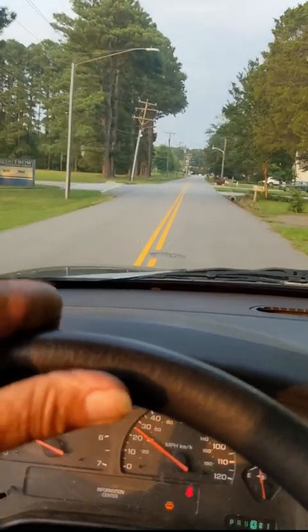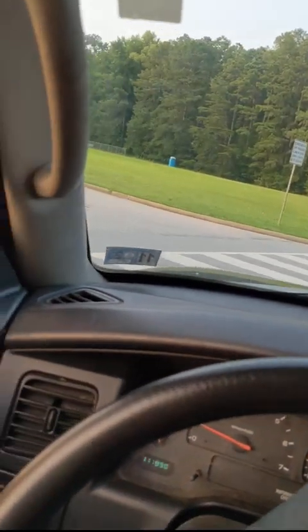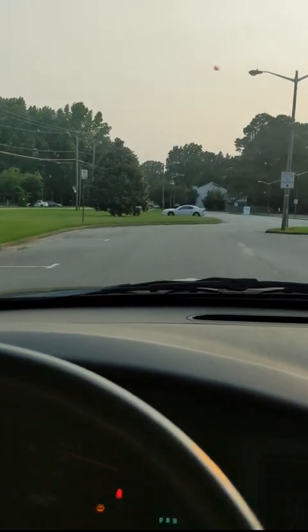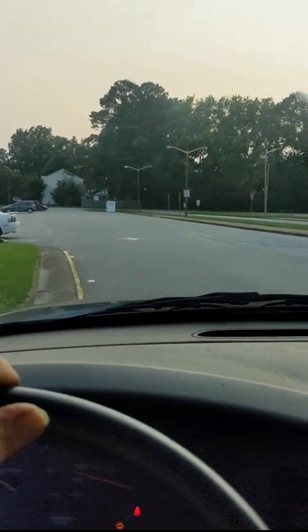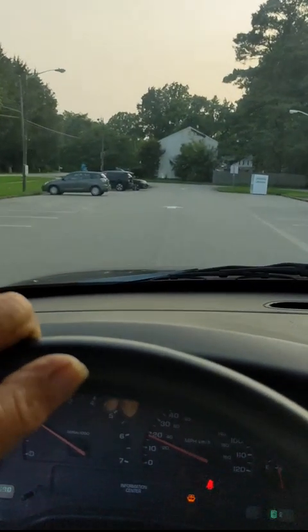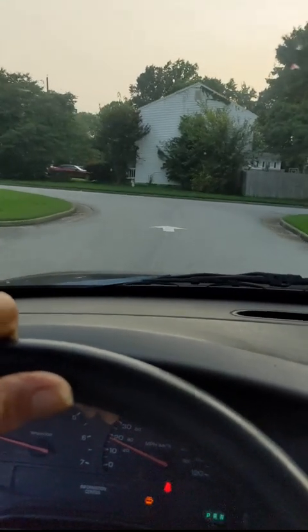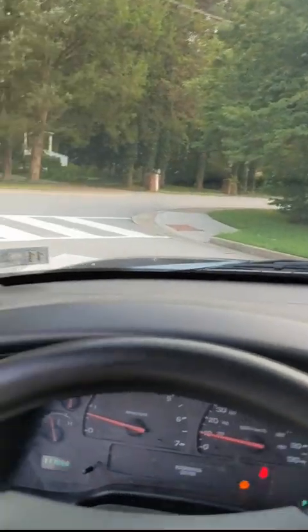All right, so the third clutch fan I put on because there were accidents and parts had to be changed out. But that last one was brand new and just didn't work from the beginning. It was always really locked in and noisy. So after a little research about fan clutches and how they work, I pretty much came to the conclusion that this is what the issue was. And sure glad I had that lifetime warranty with AutoZone, because I was able to just get down there and swap it out.